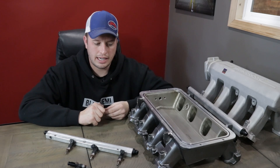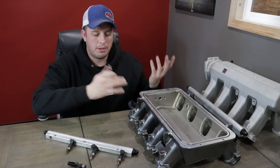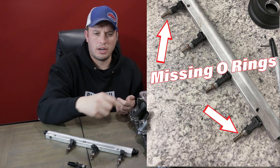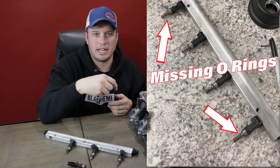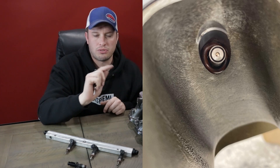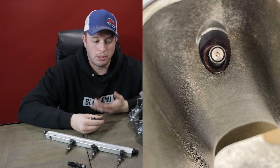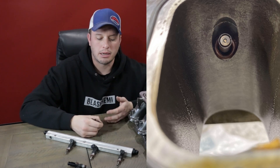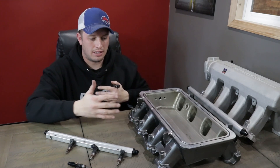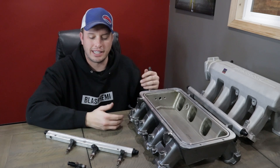We were done for the year anyway, so we took the car apart and it's just been sitting. I took things apart and was going to switch injectors and flip the intake over. As you can see in these pictures, there's a total of four injectors with missing O-rings between the two sides — three of them were missing completely, one of them was folded over. And like I said, this is my fault. When I put it together, I put a bunch of incompatible items together, which presents a lot of different questions and answers I can give you.